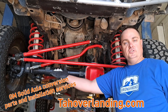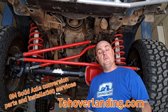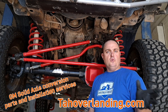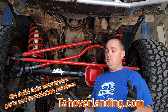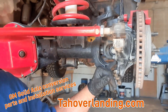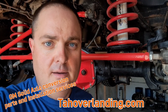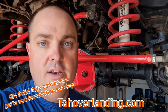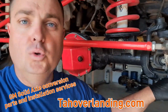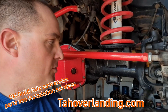First, here is the axle housing — a 2000 or 2001 Dodge Ram 1500 Dana 44. It's important that you use the 2000 to 2001 because the 1994 to 1999 won't work. Once you've gotten the 2000 or 2001 Dodge Ram Dana 44, you'll notice that the hub assembly is actually interchangeable with GMT hub assemblies. GMT 800 and GMT 900 hubs can bolt right onto that knuckle. It has the same inner spline for the stub shaft, same bolt pattern and thread — you just have to use the Dodge bolts to hold the hub on instead of the Chevy bolts, because the Chevy bolts are too short.